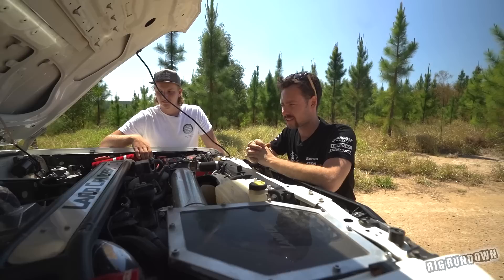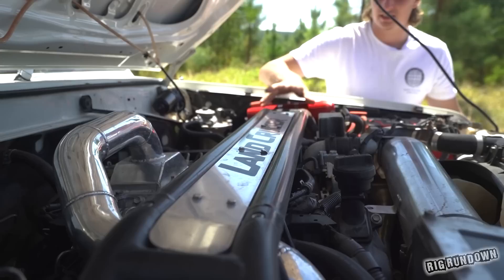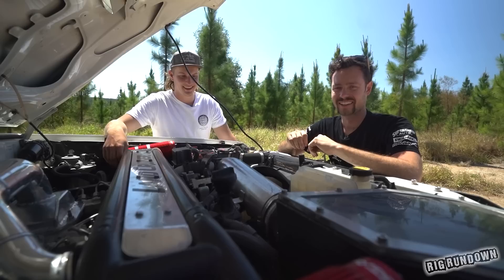Alright, let's get into the suspension stuff — we'll start with the front and then head to the back. While we're in here, this is part of the suspension: a crossover brace for the coilovers, just to add some extra support. They're sitting so much higher than standard — your coil would normally sit about another foot down but that's all the way up here, so you can get heaps more travel. I had to chop all the guards to make room for it and get the bonnet down. There are reservoirs up here and all the adjusters.